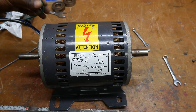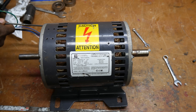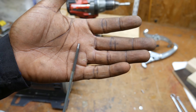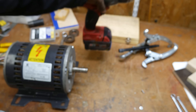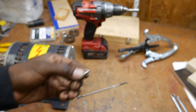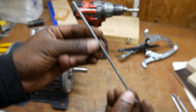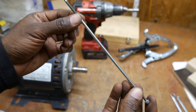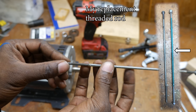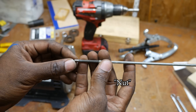My ground cable is attached to one of these bolts, so do be sure to put that back on. As always when you try to rush — I grabbed my drill and put it in to get these bolts on faster, and as you can see I stripped the threads right off the end of this screw. After some tinkering I figured out this is a 6-32 nut. I'll see if I can replace this threaded rod and re-insulate it with heat shrink. If I can't find the bolt or the cost is ridiculous I'll just use 6-32 threaded rod, cut it long enough, and put a nut on both sides. The message is: don't rush, and it doesn't need to be all that tight.